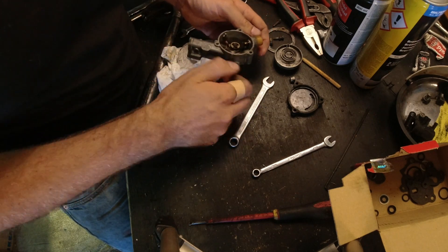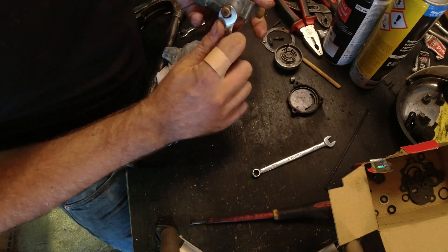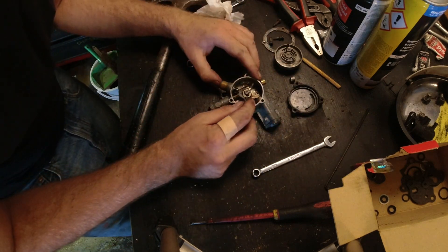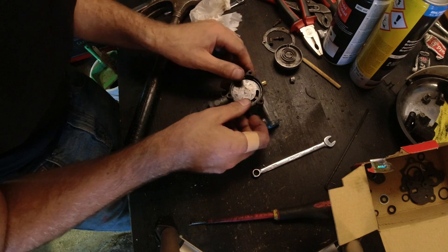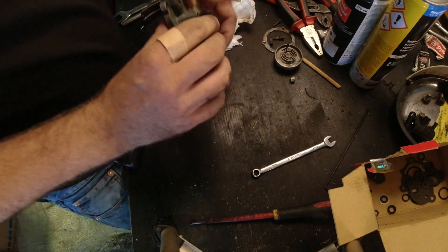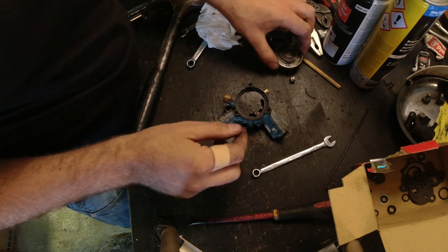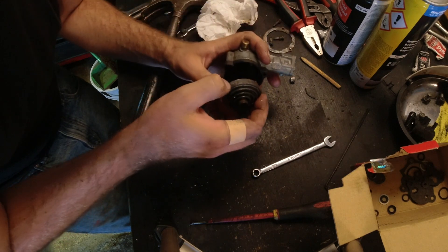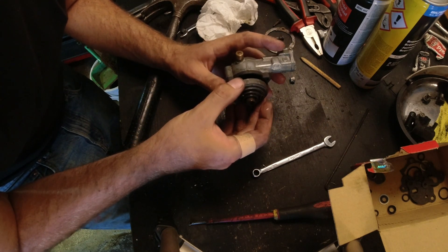Now that's moving smoothly, I'll put this back into place. Have a look — this is full choke, and that is all the way up. Put this little cover on, making sure it still moves freely. There is a notch there, notch there, and notch there — they all line up, and that is the factory setting.